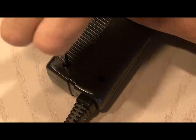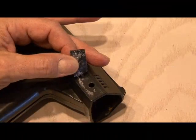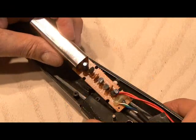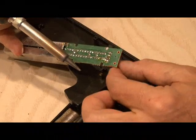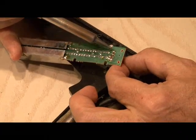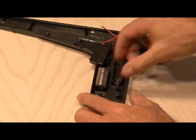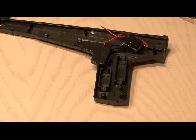First thing we're going to do is remove all the screws from the light phaser, and be sure to look for the secret hidden screws they sometimes hide. Remove the top case and that will reveal the guts on the inside. We're basically going to remove everything inside the light phaser except for the trigger and the little switch for the trigger. There's going to be a board in there — remove the wiring for that. Also you want to remove these metal weights they put inside to give it a heavier feel.